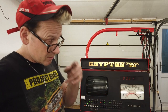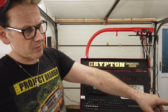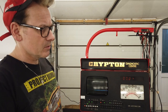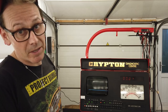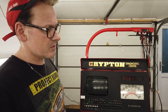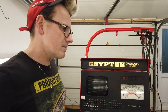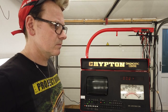And we may, just to keep you interested, put some new caps and valves onto the junior scope, the 62 junior, and see if we can get that scope coming to life, because that's the hardest job, is the scopes. Well, it might not be when I look at the way the gauges work, but I know there's a lot of work to do on those in terms of capacitors and valves. There's not many discrete components on there. There might be a selenium rectifier, not sure.